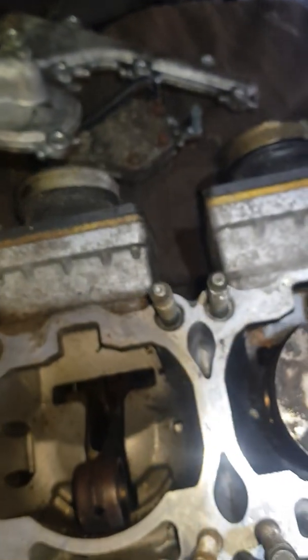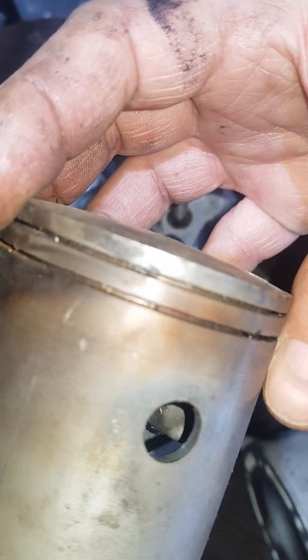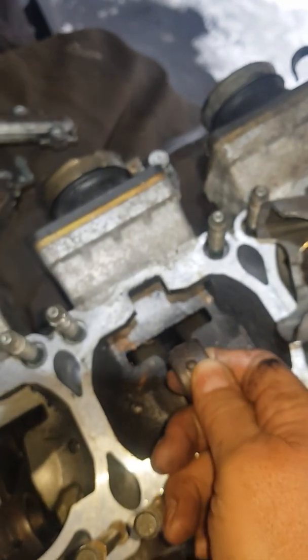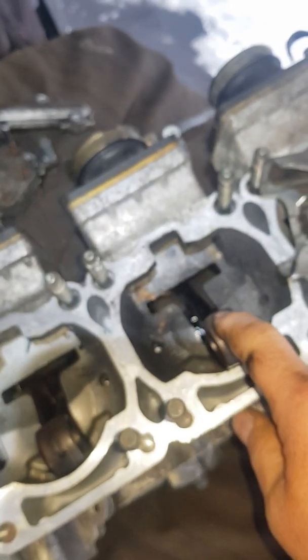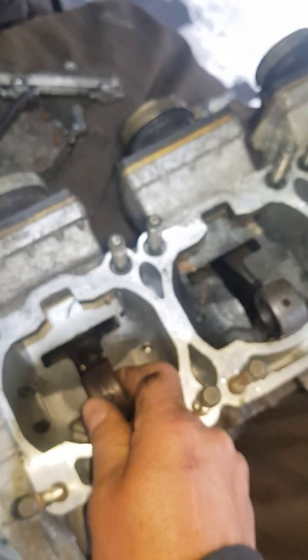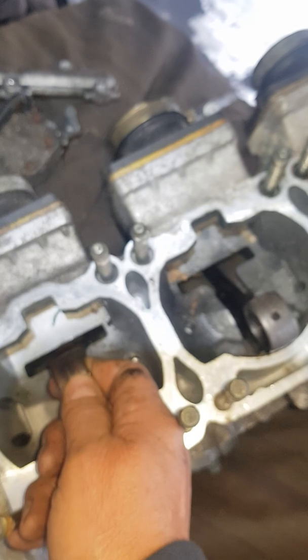When you put the new ones on, the first thing you do is make sure your rings are in place. There are a couple of notches where the ends of the rings go. There's an arrow — the arrow should go towards the front of the engine. Once you get this off, you're going to check for bearing play up and down. This one has bearing play, and these cranks are very expensive. The problem with these cranks is they have welded pins and not many people want to work on them. Check your up and down play — not side to side, it's up and down play — if you've got the machinery to do it.